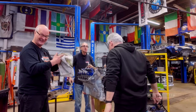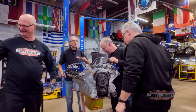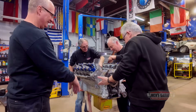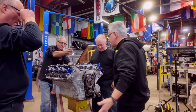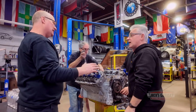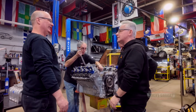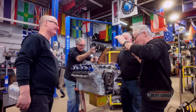And what do you think of the timing chain? It's a double roller. Great, you got something good. Besides being a double roller, the markings are clean. They didn't come off. It's a brand new setup. Exactly. It's never been run. There's no way it could run like that. Any more than one or two teeth out, it would not start. You don't have a horseshoe, you have a whole corral.